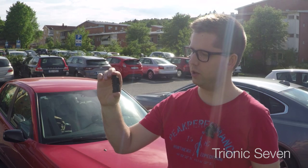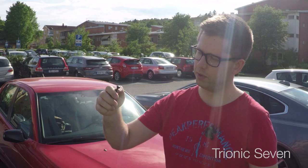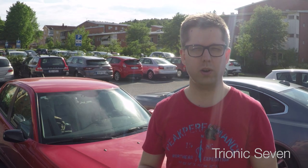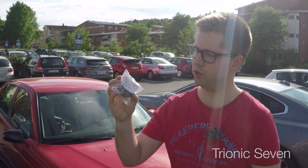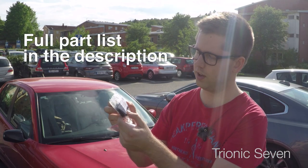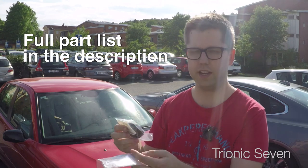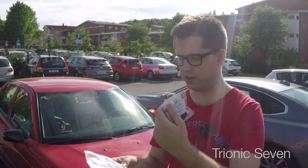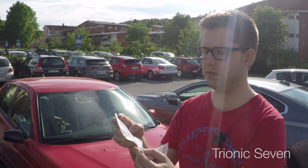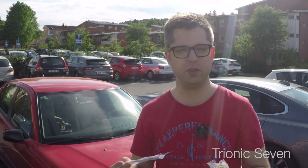If you have a five-door or wagon you will also need the rear light cluster inside the trunk. Then you need the hood switch - I bought this one used. The rubber is slightly damaged but I got a very good price for it. You also need the receptacle for the hood switch. It sits in the hood and has part number 127-82929, and this cover is held into the hood with a single rivet, part number 921-53060. Except for the siren, none of these parts are very expensive and you can buy them new for a small cost.